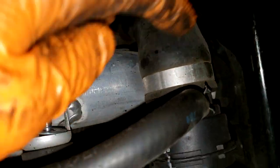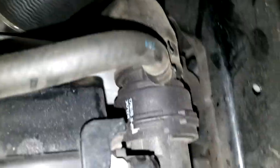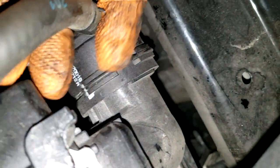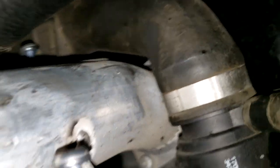In order to do this I'm probably going to pull this hose, so I'm going to have to be draining the coolant anyways because we're going to be pulling the water pump and the front timing cover. I'll pull this here - it's just a thing you pull up, just pop the hose right off, it's easy. You can see those Torx bits right there and right there, and this goes into the intercooler it looks like.